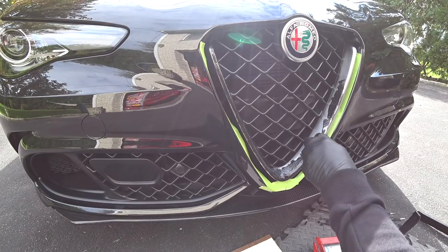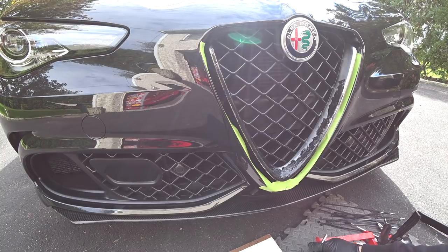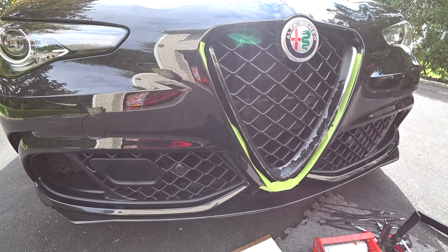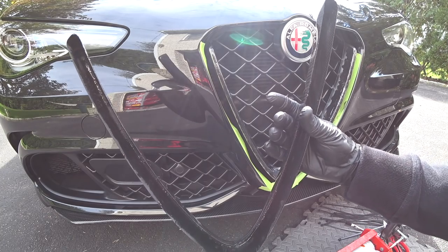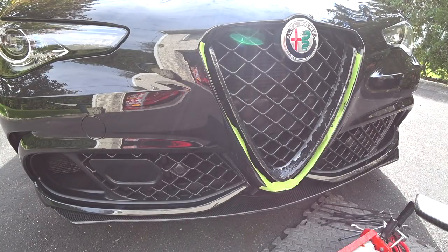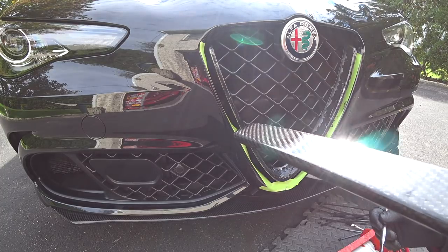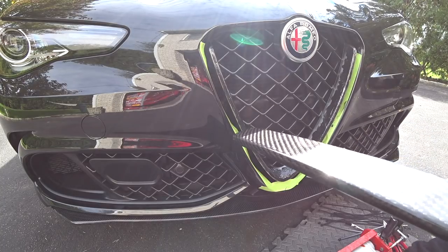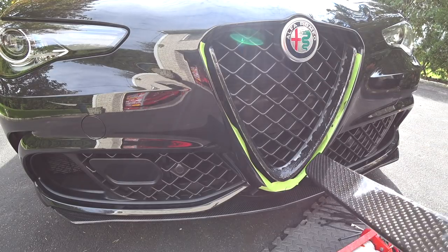By covering all surfaces you're going to guarantee you won't get water in there. Here is the grill insert — I went in with the acid brush and some more adhesive and got all the dry carbon surfaces prepped with even coverage. This guarantees a permanent installation. That's exactly why I don't like to use tape on something like this, especially when it's overlaying a factory part and you're exposed to multiple seasons. This is just the right way to do it.